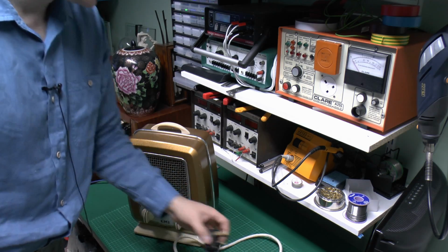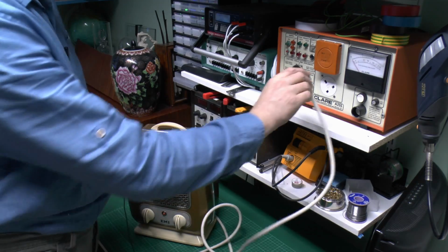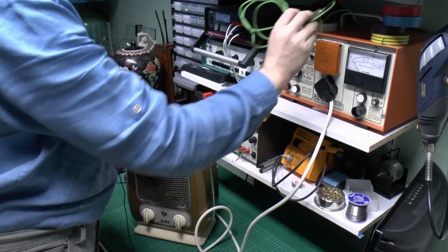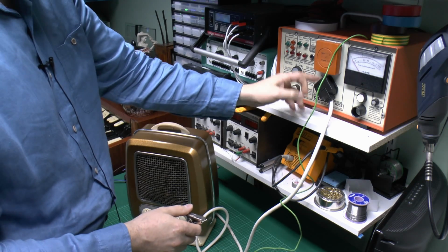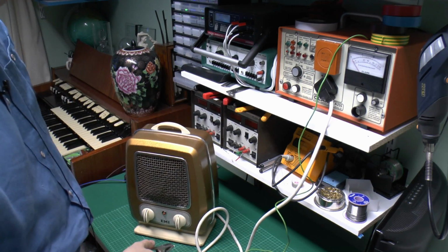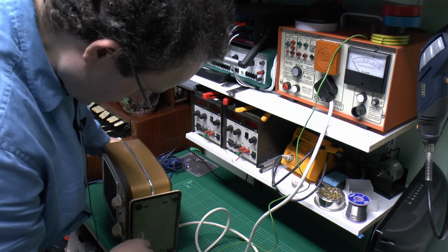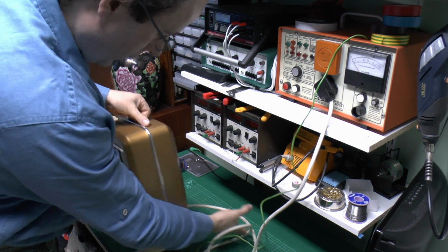And for testing we use this machine here, which I have shown in other videos. So I'm going to get in the plug and connect into the front there, and then we need to use this green wire. This is to check that we've got continuity on the earth between the actual earth pin all the way through the flex and therefore to the metal casing of the device. So just find some suitable bare metal to attach to. That bottom plate will do.